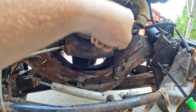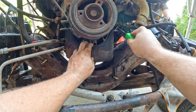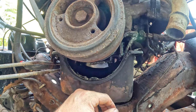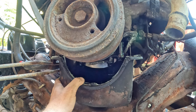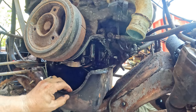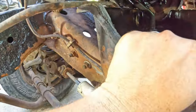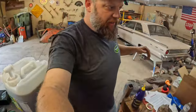The pan's going to have to go down and off the back. Get behind it and be ready to pull it out once it comes all the way down. It turns out if you don't want to remove the pickup tube, you've got to get the engine pretty high — the pan pinches between the block and the bell housing on the transmission. You just can't get it out of there. Also need to take that dipstick tube out. Pro tip: make sure you're cutting the dipstick tube, not the trans cooler line.